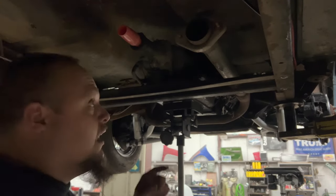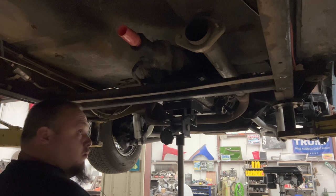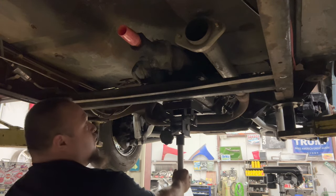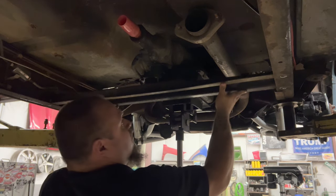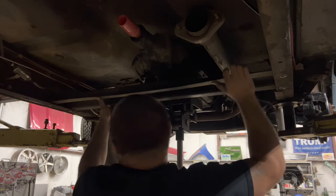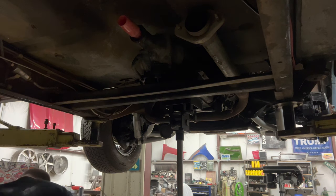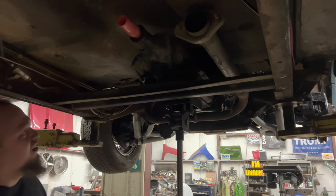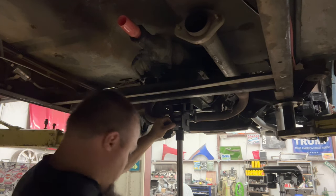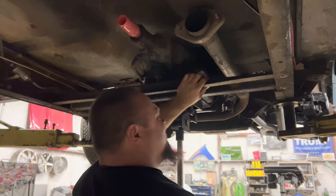All right, so I got the four bolts plug welded in. I'm gonna test fit it for the first time with y'all. Let's see if we can even get this cross member out once we've done this. It ain't looking good. It's hitting the freaking transmission mount. Will it go up any higher? That's it. That's what I was worried of.